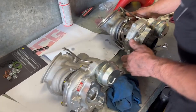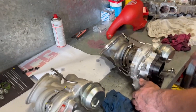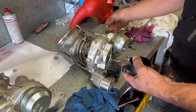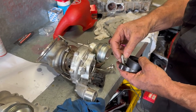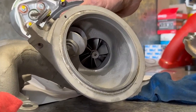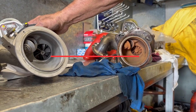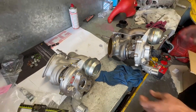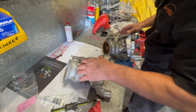Let's take it in. Someone's taken off the bottom part as well. All we need to do is measure the differences quickly. Let me take the intake off. You'd get a larger one of these - it's aftermarket, but when they've supplied the bolts, the bolts have obviously been too big, so someone's had to grind them to make them fit in the housing. You can see the amount here - definitely an increase on the exhaust side as well. Both have been increased and that's all they change.